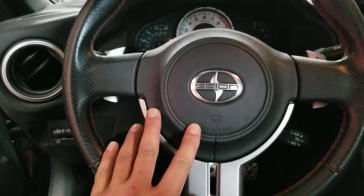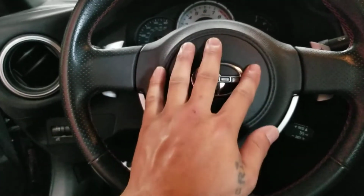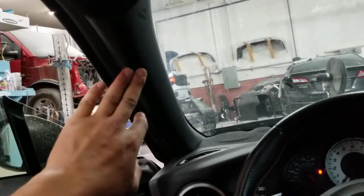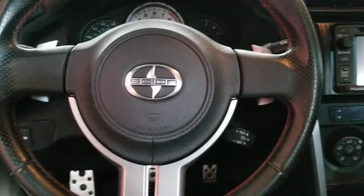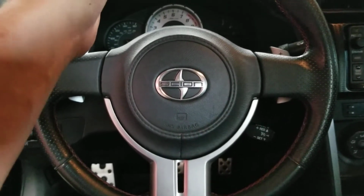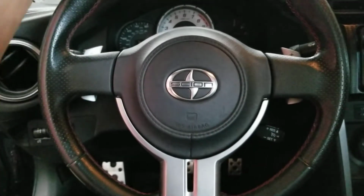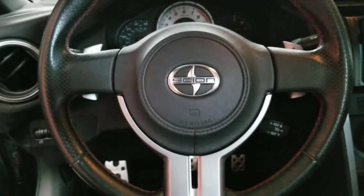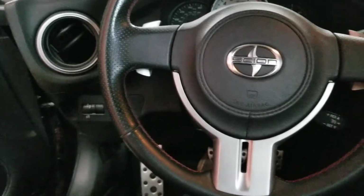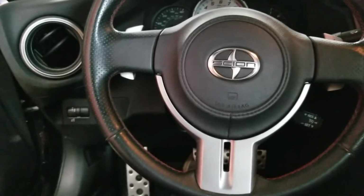because it wasn't a hard enough wreck to deploy the airbag. We had to replace the clock spring. The whole assembly had to be replaced. The curtain airbags were deployed. We replaced the front end, everything that was damaged in the front end. So that means new fenders, new bumper, new hood. The door had a little damage, so they paid for repair on that. And the quarter panel, because of the door being jammed, got work on too.